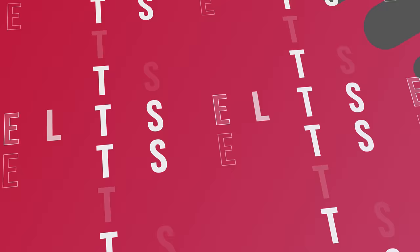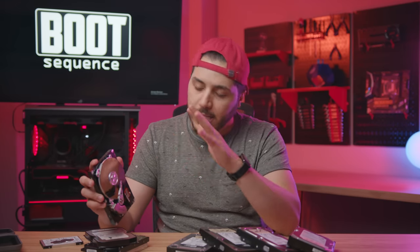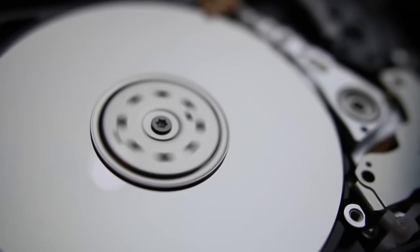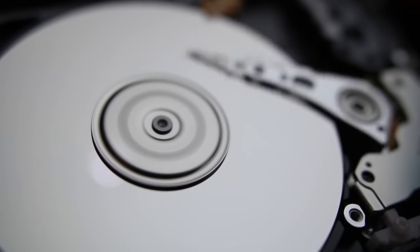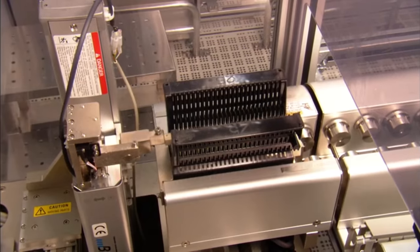I had this one open already. The platters — they spin very fast, and they also spin very close to other components, so it needs to be stiff and hard so it doesn't warble. Essentially, the platter puts the 'hard' in hard disk drive or HDD. That platter can be made of metal, as long as it's not magnetic. The most commonly used metal is actually aluminum, but you can also have them made out of glass and even ceramic. The material just needs to be stiff, hard, and non-magnetic.